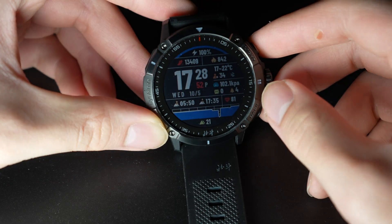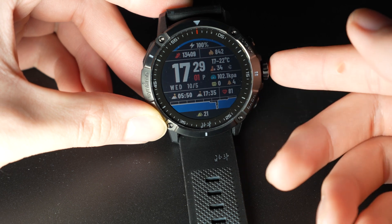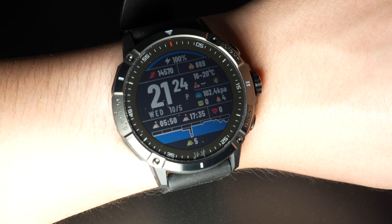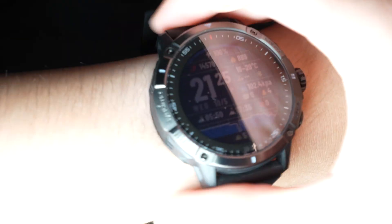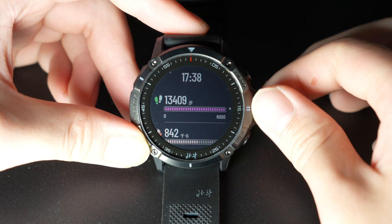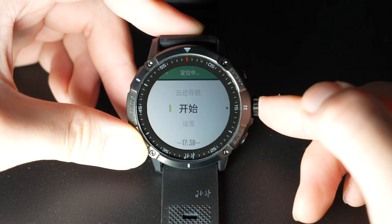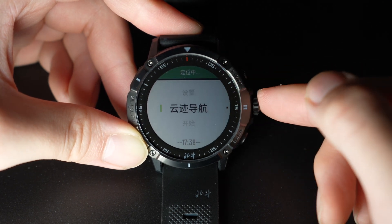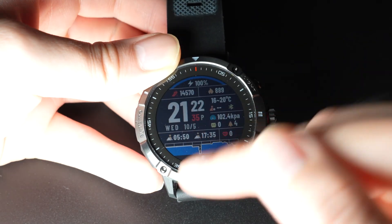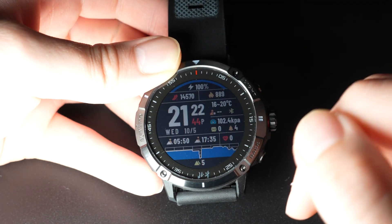The watch has an optional lock screen mode that activates if you haven't touched any controls in a few minutes. To reactivate, simply press the knob down for around three seconds. This lock screen mode is quite necessary because it is possible to accidentally bump the knob and cause unwanted control inputs. When on the home page, turning the knob cycles through vitals tracking, weather forecast, exercise history, and phone notifications. Short pressing the knob gets you to the exercise programs menu, and the control scheme is also replicated with touchscreen gestures — swiping up and down is the same as turning the knob, while swiping right and left substitute short pressing the knob and pressing the back button respectively.